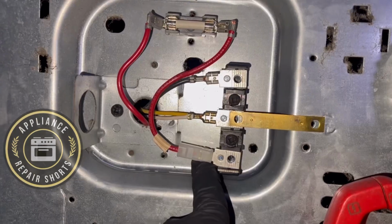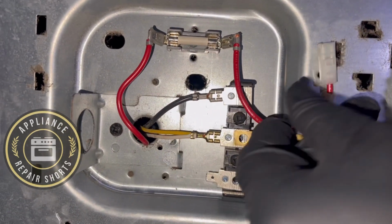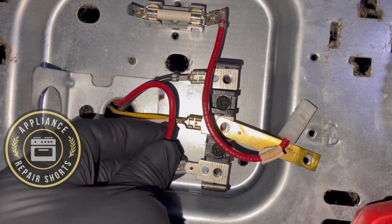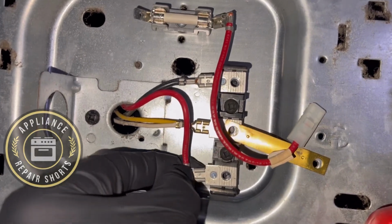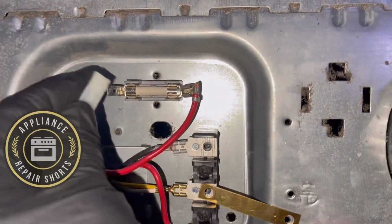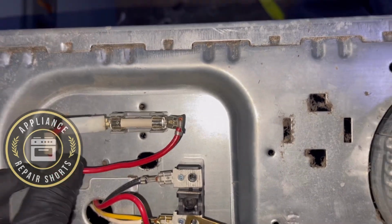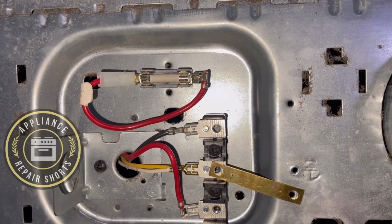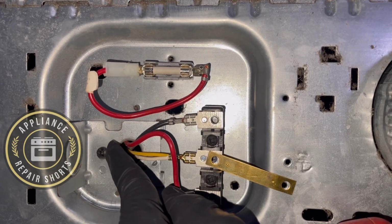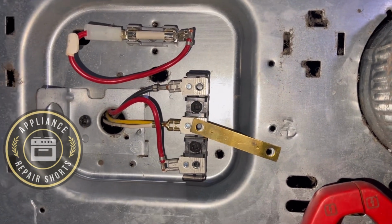Do it right. So, in fact, all you got to do, remove this one and take this one off. Bring it over here. Connect that. Make sure it's tight. If it's loose, crimp it down a little bit, make it more snug. And then you can leave this here like this just for now until you can replace the fuse. Just tuck it away, leave it alone, and the dryer should be good to go. But if the issue of the blown fuse is not fixed, you might trip your breaker or you might burn those wires and you're not going to be fixing anything.